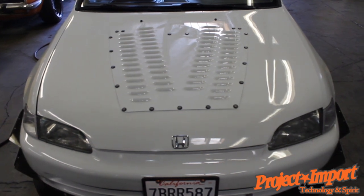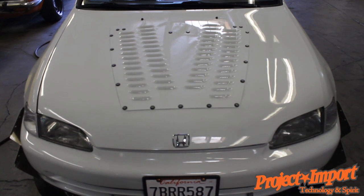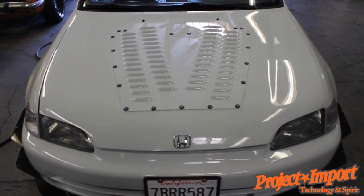So if you're having problems with cooling efficiency on a turbocharged B-series or K-series car, you might want to look into adding a louver plate to remove hot air out of the engine bay.